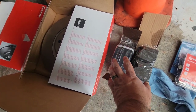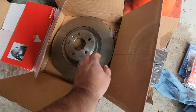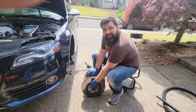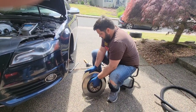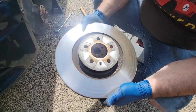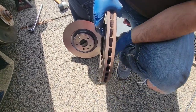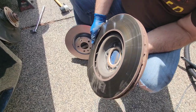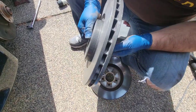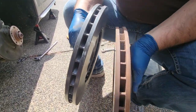The Hawks stopped amazingly on the Boxster but made a lot of dust. These are a different compound so hopefully that's not an issue. We also have these Brembo rotors to put on the car. Here are the old rotors — they're Mayle, like an OE equivalent replacement. On the street they weren't bad, but on track you can see how thin the rotor material is and there aren't many vanes. The new Brembo blanks are noticeably thicker, especially on the front face.